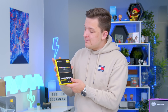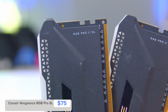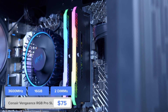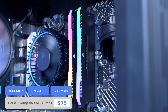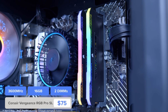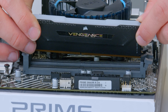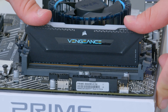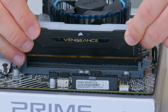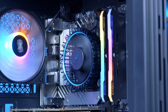For the memory or RAM in this build, I've gone for Corsair's Vengeance RGB Pro SL kit. You can go for a range of capacities, but I'd recommend two 8GB DIMMs for this build, or 16GB of overall memory. Technically, the graphics card config we've gone for could manage with just 8GB, but to be honest, it's just not enough in 2022 and will create bottlenecks both now and when you go to upgrade the system later down the line. This kit slots into the RAM DIMMs nice and easily. Apply a nice bit of pressure on each side and it will click into place. Line up the notch on the RAM DIMM with the notch on the DIMM slot itself, align the two up and push it down — your CPU, RAM, motherboard, and cooler are all installed.